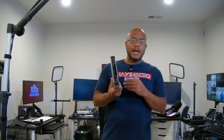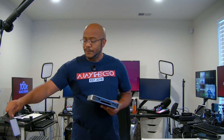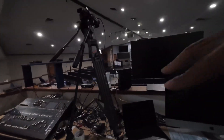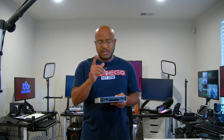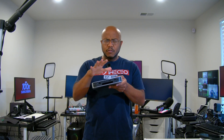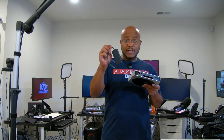They have a Mac Mini like I have here, and one of the issues with the Mac Mini is how many outputs are supported. Mine actually only supports two - a regular HDMI out and then maybe through a dongle adapter like this Anker one I use on occasion. At the church, we're trying to solve having multiple Macs running multiple ProPresenter licenses, and we want to consolidate all of those into one system so that one Mac can handle the digital wall, the TVs, everything. But how do you do that when you can't add a new graphics card and the hardware only limits you to two displays?